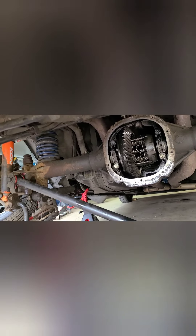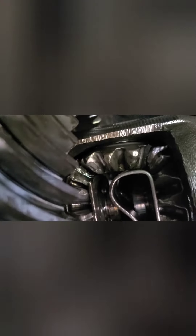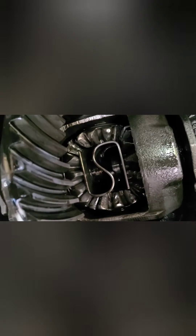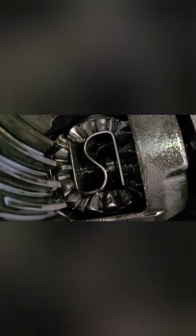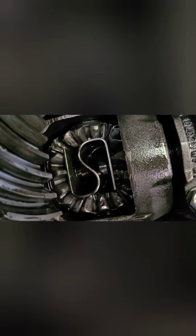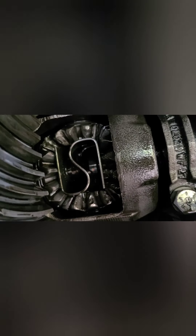I think I've got something broken in the rear end. After pulling it apart, you can see the spider gears right there - they are chewed. Let me rotate this. Definitely took out my spider gears, and that was what was causing the binding and the popping.